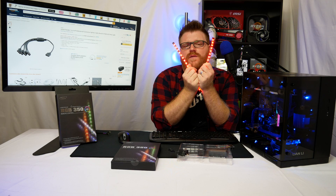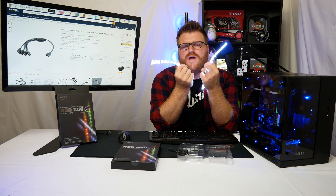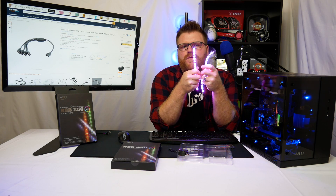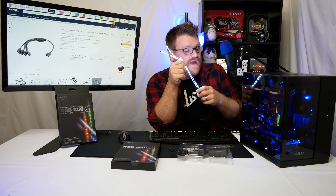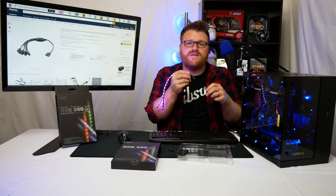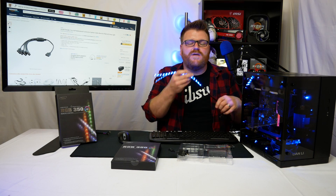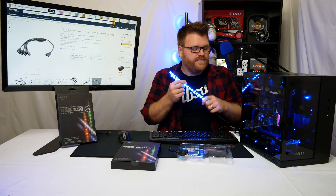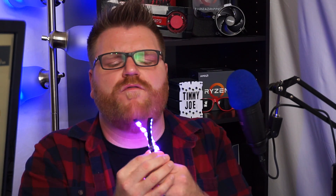RGB on a budget — count on spending or at least putting some forethought into a few extra things. If you don't want to use molex and you're using RGB headers, you'll probably need an extra splitter if you want to run more than one off of a single header. If you're buying two or three kits, make sure your cables will reach — you might even need an extension cable for far spots in your case, like if you're putting strips around a window panel. Follow me at Timmy Joe on Instagram and Twitter.